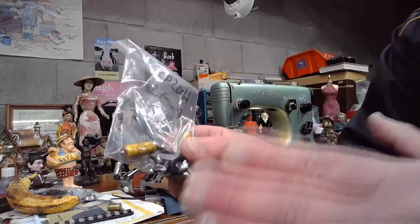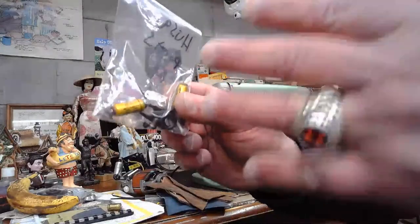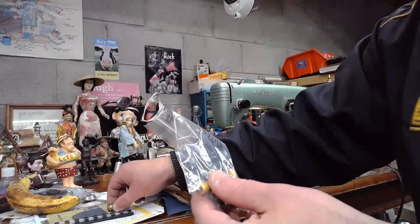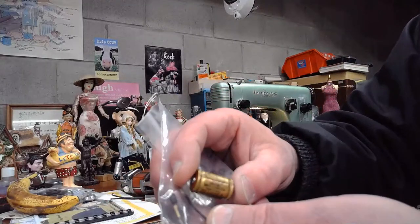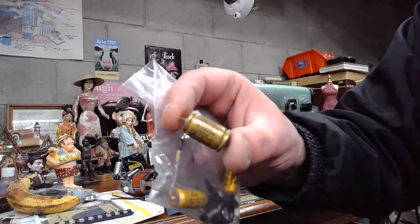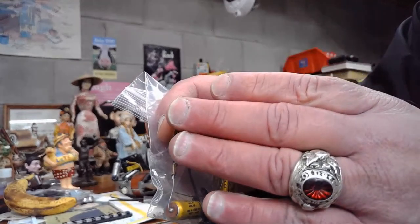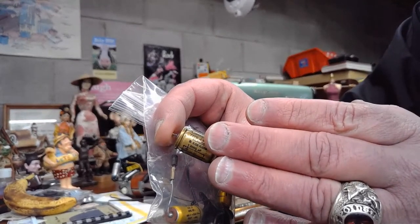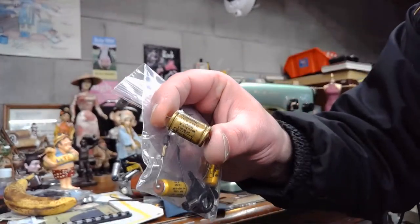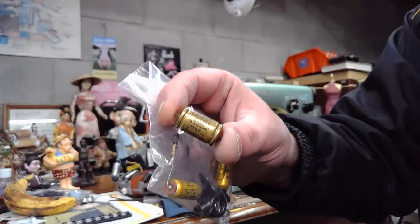They help with the motor startup so that the motor starts up and you get immediate, nice, even flow of power. But they also will function like this component right here that created a lot of problems for Patty Landers out of Texas. What this one does in the foot controller is it backs up that electricity and temporarily stores it. And then it's supposed to evenly distribute that power from the foot controller to the motor.